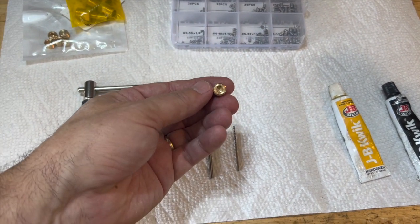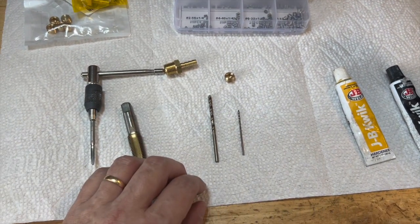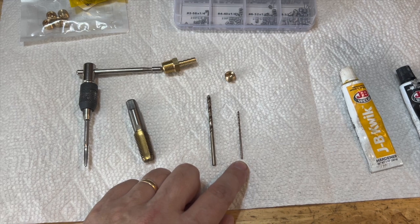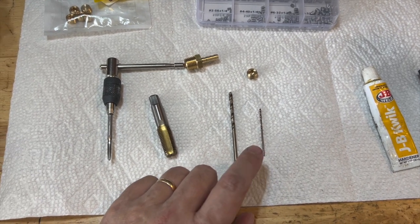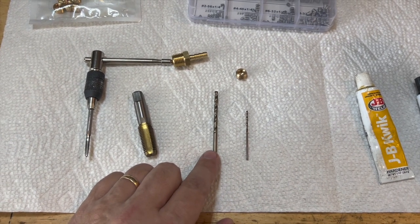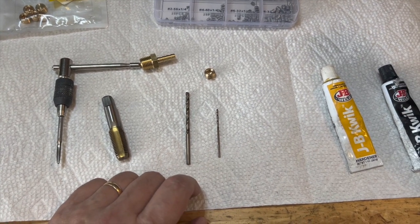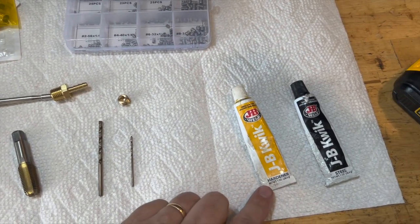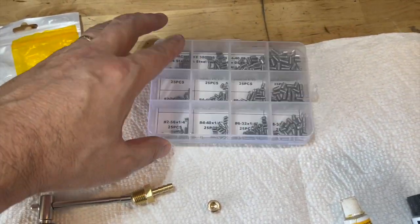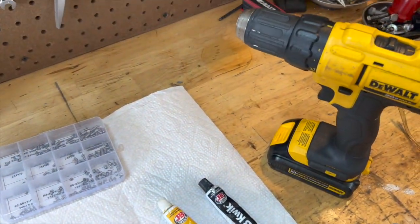You'll need a plug to block off the port where your original vacuum advance hard line is located on that Holley 94. I like to start with a 1/16th drill bit just to get that hole started — it is kind of difficult because it's angled right there. Then also a 1/8th of an inch drill bit, which makes your passageway there for the vacuum to go through. Back to that port: some JB Weld, or you can also use some soft lead. A 6-32 set screw — I've got a pile of them here. And of course, a drill or a drill press.